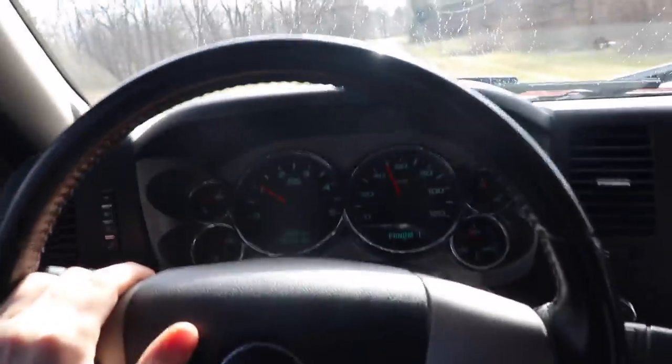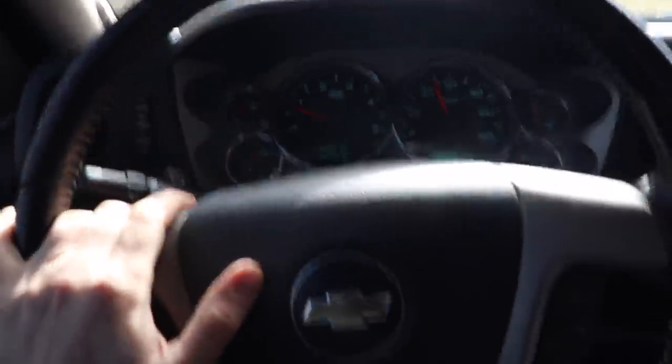Except for a little bit ago, we had this vibration in the front end and I just took it by the shop. I told the guy I was going to drop the truck off for some strange vibration in the front end, but I did just put new wheels and tires on it. I jacked it up by the A-arm on each side and then set it down after I put the wheels and tires on. He said I might have lifted those ball joints up out of place a little bit, and since they weren't quite lined up perfectly and settled down where they're supposed to be comfortably, it might have been creating a little bit of vibration — just over 45 miles per hour it was starting to vibrate a little. After about 15 minutes of driving it completely stopped and it was straight as an arrow again.